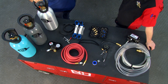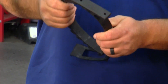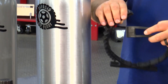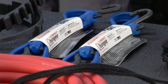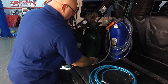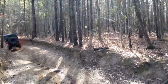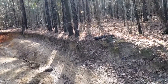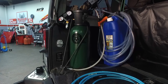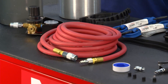It's got a bunch of other functions as well, which we'll get to. For mounting inside the vehicle, there's a quick-fist bracket you can bolt onto a wall, and it straps onto the tank and grips down with a pretty good rubber grip. We also include a couple of bungee cords — unlike a hard metal bracket, if you roll the Jeep or hit a hard bump, the hard metal bracket can shear, but the bungee will just stretch and pull the tank right back. We also include a high-pressure rubber hose, 25 feet, which is enough to get to all four tires and then a little extra.